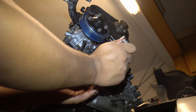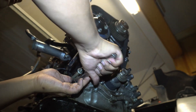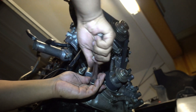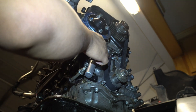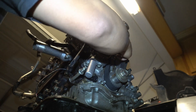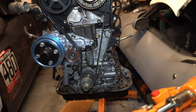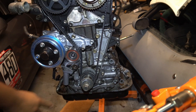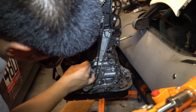The tensioner is about 20 pound feet of torque. I do not have a torque wrench that can go that low, so I'm just going to go by feel — just tight enough, I guess. Now what I'm probably gonna do is get a wrench and bring this down a little bit so I could pull the pin on the tensioner, that way it doesn't just whack at it and possibly do damage. So that's on. Since the timing is pretty much good, I figured I might as well pull this pin for the timing tensioner. Three, two, one. It'll be good. Pin is out.